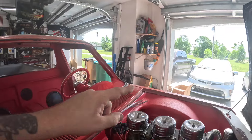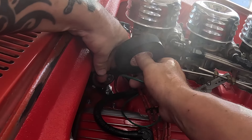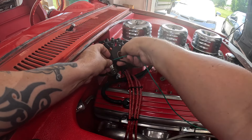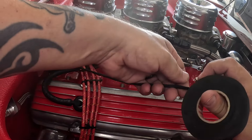Out here I'm going to grab both of these wires together, tape them just a few inches, and then one will go down that direction for the oil and one will go this way for our water temperature. If we had more wires going in the same direction we'd tape them all together, but we only have one going each way. Now that we've got those taped up, we're going to pull it back through into the dash a little bit, just until the end of this tape is in our grommet — perfect.